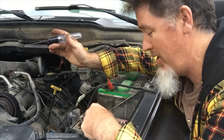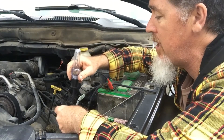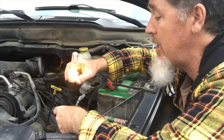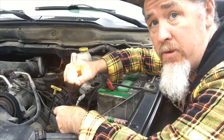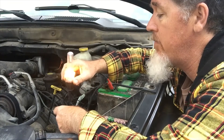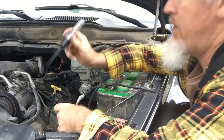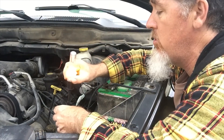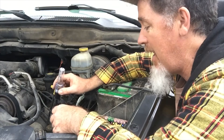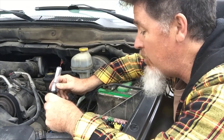For the final diagnosis step, I pulled out the fan relay and installed a jumper relay I carry with me. Using a low impedance test light — around four to five ohms, so high amperage — I probed the connector going to the fan and confirmed power is good. Then I flipped the test light to the positive terminal and tested the ground to the fan — ground is good. So it looks like it's a bad fan motor. The good news is the fan is easy to get to, so we'll order it, replace it, and have working AC again.